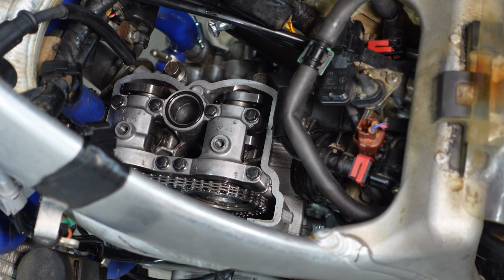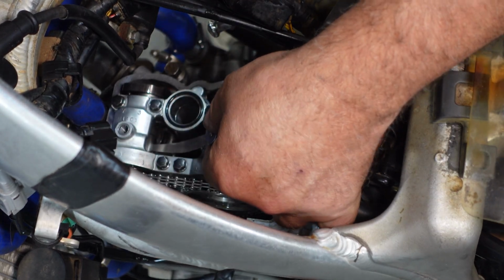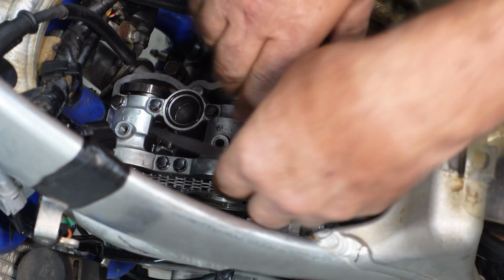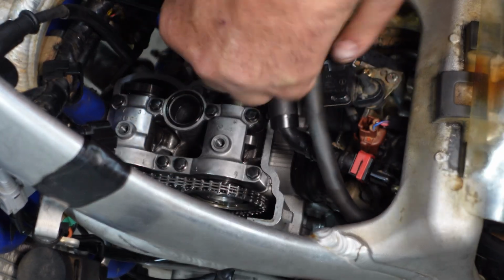But let me go ahead and take a measurement on my exhaust. I don't have a 0.17, so we're going to go 0.18. And again, that should fall right through. And then I don't think I have a 0.22 either, but we'll go a 0.23. And if that doesn't go through, then I'm going to call the exhaust okay. And that falls right through too.